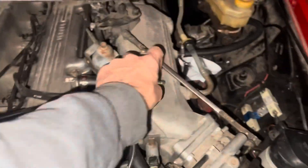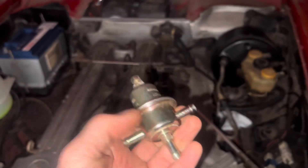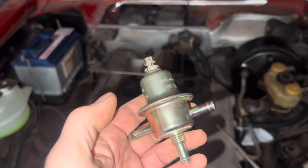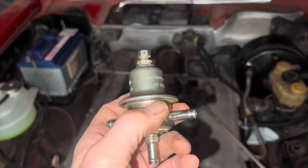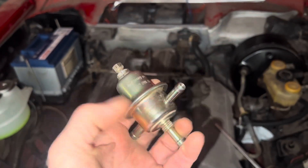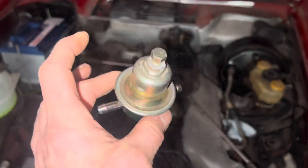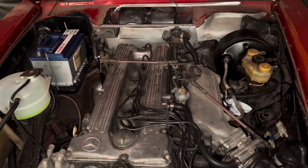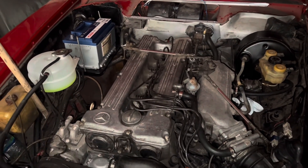We've gotten one step closer — we now have the correct fuel pressure in the system. We've changed the fuel pump and the fuel pressure regulator, and confirmed that just because something looks new and shiny doesn't mean it works. I'm going to try bringing the original fuel pressure regulator back to life by running a special injector cleaner through it at 30 psi to clear any debris or varnish on the diaphragm, as these are phenomenally expensive. In the next video, I'm going to move on to the injectors — cleaning them and testing both the electrical impulses and spray patterns.